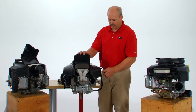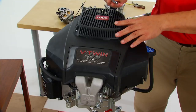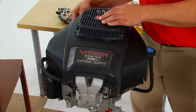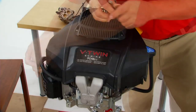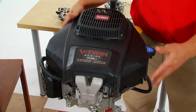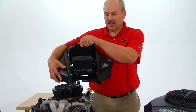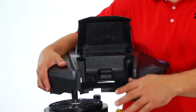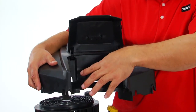The next thing I'd like to show is what's underneath the shroud. You have six mounting bolts that hold the shroud on. Since this is a prototype engine, we have some of the components off already. I'll just loosen these up quickly, remove the air filter, and remove the drain hose. Once you take the shroud loose you can see the robustness of the hinge, and you can see the air filter chamber has a slanted floor with three cutouts so the flywheel air is pressurizing and blowing the dirt and debris away from the air filter chamber.